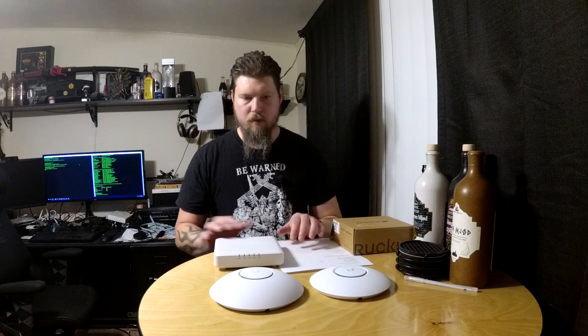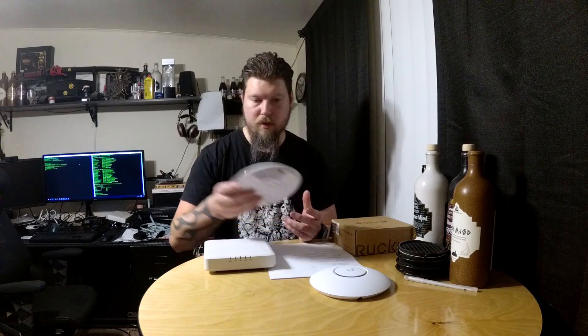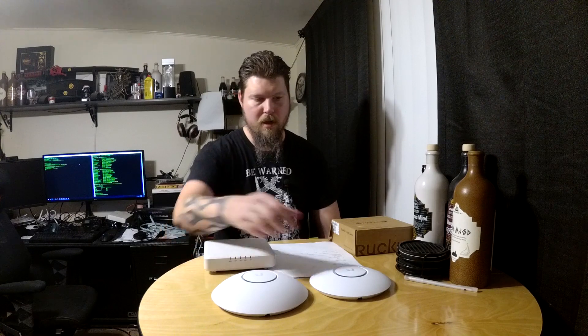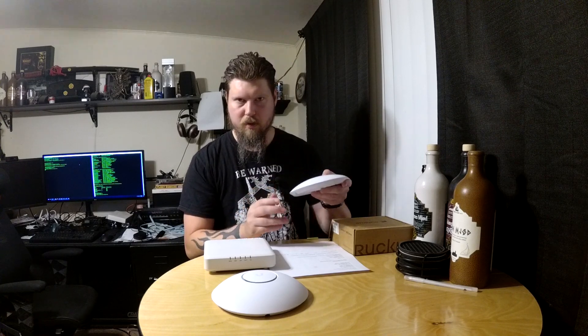The AC-LR long-range unit is really good for 2.4 GHz but has really poor 5 GHz. I bought the long-range model because it was advertised as being great with mobile devices due to special antennas. Most stuff in this house is mobile devices on the wireless network. But in real life, it doesn't really make a difference — it's more marketing hype. Just because the access point can reach further doesn't mean the device can reach back far enough. So the Nano HD, as cool as it is, isn't great either — it has super good 5 GHz but they really nerfed the 2.4 GHz.